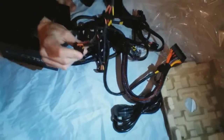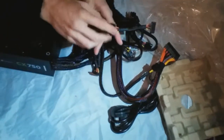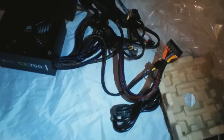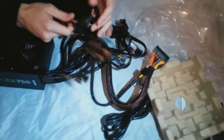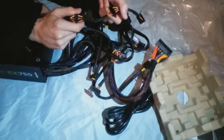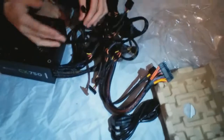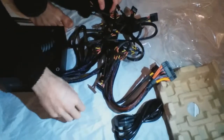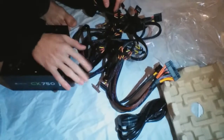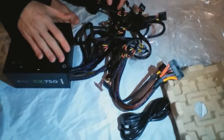These ports are what you plug other cables into — you get lots of different sets of cables and plug them in here, then they wire off to various components. There are lots of them and some have labels. For example, one is labelled SATA — that's for SATA power connections to your hard drives. It's got a nice bunch of connectors. Just remember, for the four pin which goes into your motherboard — if you have that port, make sure you buy that cable beforehand. We bought the power supply but forgot to buy that cable, so now we have to wait for it to arrive.